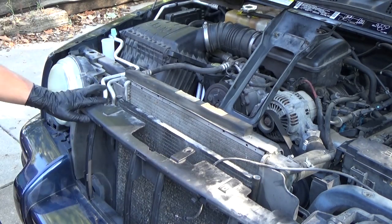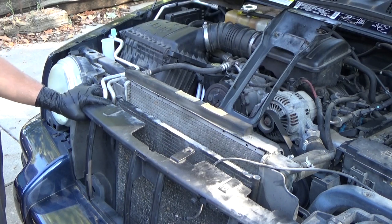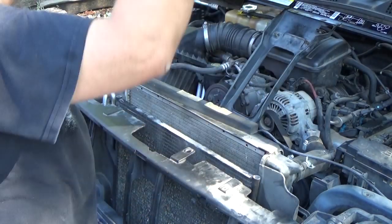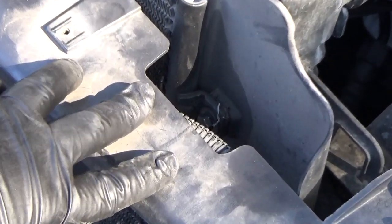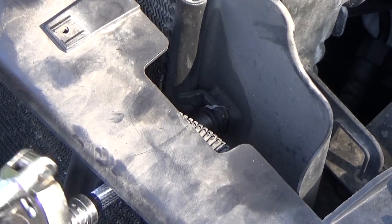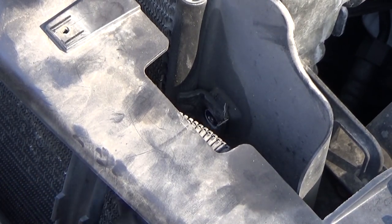Now, we'll pull the two nuts that hold these lines in off the condenser here, and this bolt that holds the condenser in, and the condenser is going to come straight up and out. So let's get to it. Right down here on the condenser is where we're going to get the first bolt out. Come at it right there and loosen it up, pull it out,